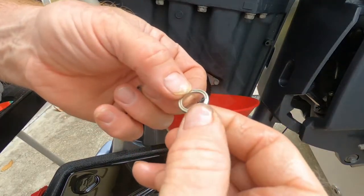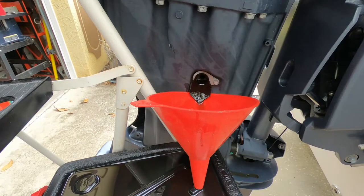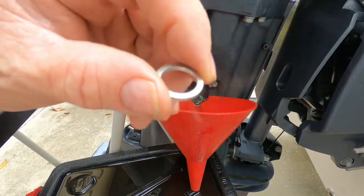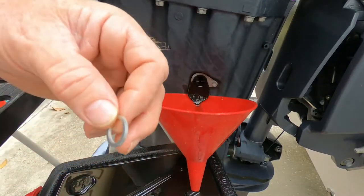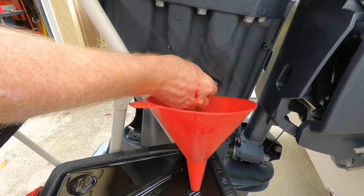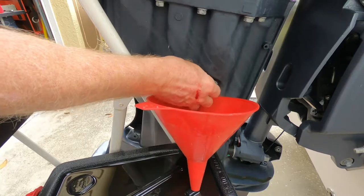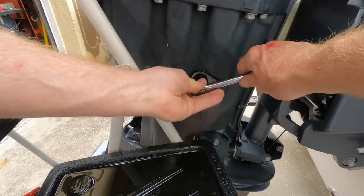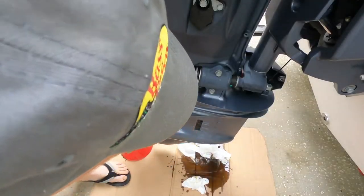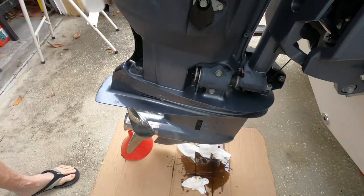You can see here this is the ring that came on it. They suggest that you put a new one on every time, so we're going to replace that when we put the oil back on — just let the oil drain for a while. Here is the new ring; this is a genuine Yamaha part, and I'll list all the part numbers I'm using in the description below. We're going to put the new ring on and start it by hand — always want to start these things by hand so that you don't cross-thread the threads — and then tighten it down with the wrench. Give it a good snug but don't over-tighten it. While you've got your side panel off, just double-check for corrosion; salt water can get in this area.